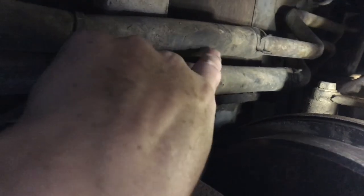So now, in order to get rid of these heaters and the hoses, obviously these hoses need to be disconnected. And what I actually want to do, if I can hold the torch and the camera in one hand, it's a bit tricky. Rather than just capping these hoses off and having two blind ends, I want to be able to loop it round so that the coolant can continue to flow freely back through the engine. So I need to be able to disconnect these hoses here where they're clamped onto the metal pipe, and I've got a short loop of hose that I'm hoping will fit there. But it's just in a really awkward spot.